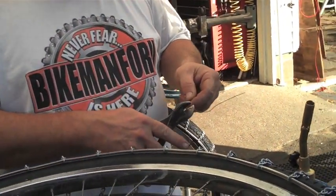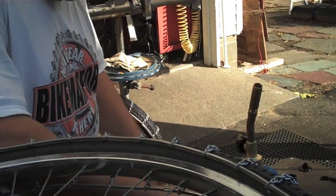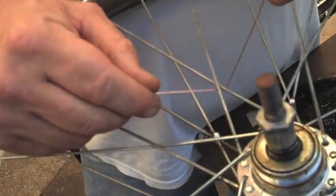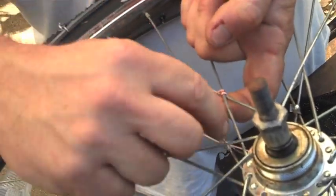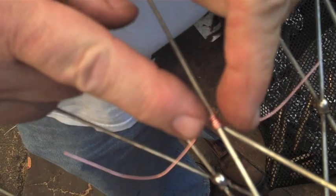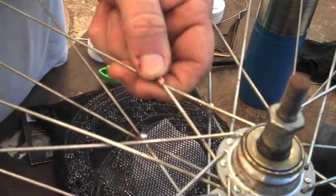We need about six inches or so. Let me cut a bunch of these so we're ready and you can get the idea. We're going to go right into here like that — like you're lacing up your boots. Nice and even, nice and tight. Go two to three times around this way, and then two times with the other part — two to three times with the other one. Push it in with your fingernail, make sure it's nice and straight. Come up to the top, and now we're going to twist these together making a little pigtail. Give it a little snip — leave it about a quarter inch or so. Bend that quarter inch right down into that.